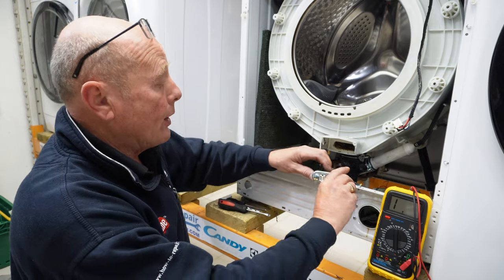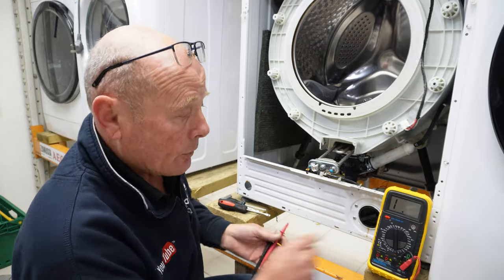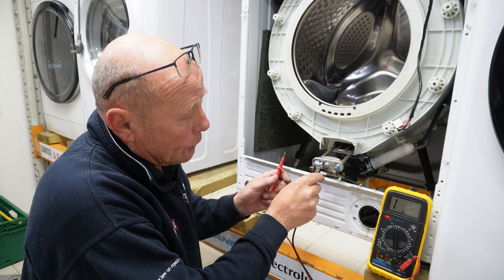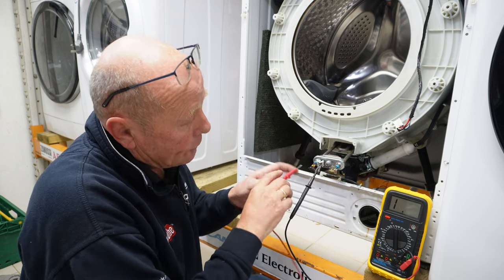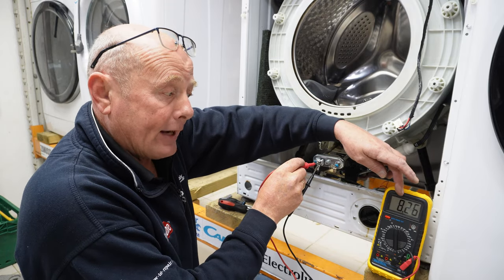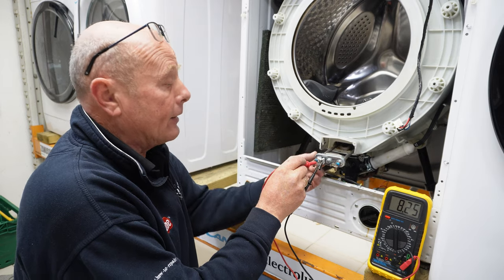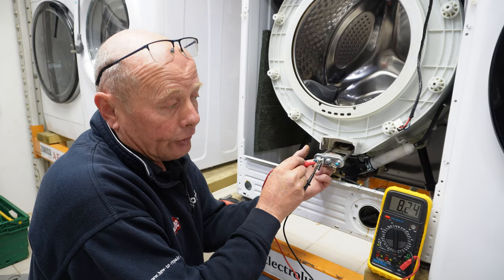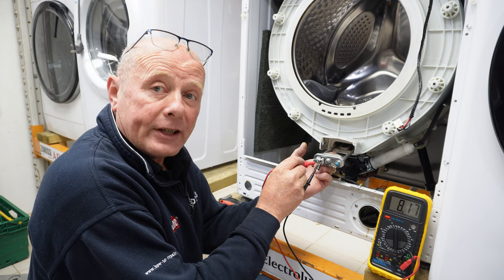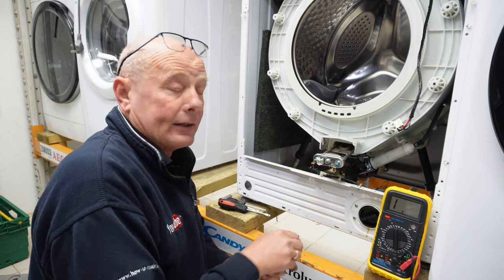And let me just show you the NTC sensor moving as I warm it up slightly. So leaving it on 2K range. Okay, I've just put some crocodile clips on this for you, so I get a good reading on this. Now, as you can see, I've already handled the element, so it has moved slightly. We've got 8,260. If I put my finger onto the NTC sensor, you will see this number start to drop, as you can see here.